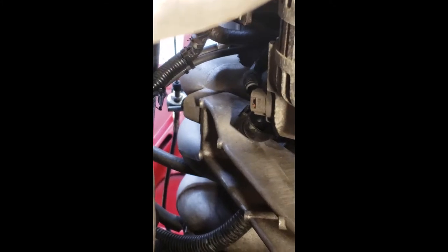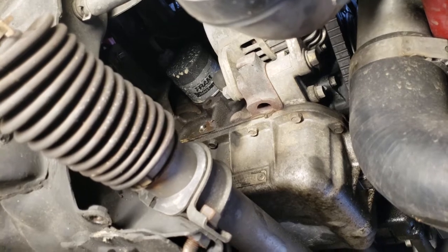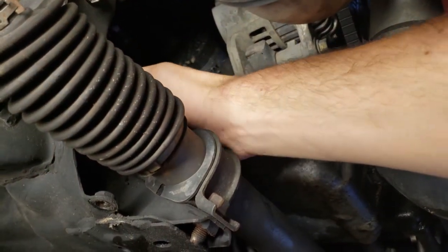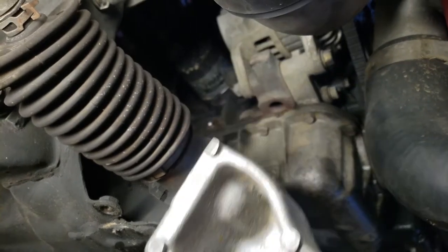According to Flying Miata's instructions — which I didn't actually throw away, that'd be dumb — they say you can take that brace away and not even bother putting it back on, so that's what I'm going to do. This bolt is a 14-millimeter, and I would assume the one up there under the throttle cable is also a 14-millimeter. With that brace taken off, you can definitely see what you're going to be working with a lot easier.